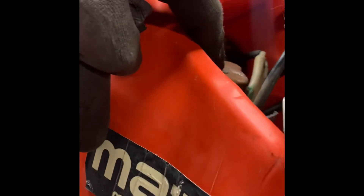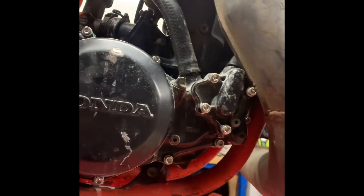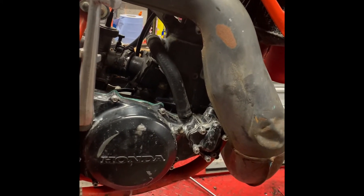Having had just another quick look around, I've noticed there's no rear brake pedal on the bike at all, and there were no Jubilee clips on these hoses for the water pump, so there's no water in the radiator. It looks as though these are fresh gaskets — it looks like someone's done some work here and they've replaced the bolts for stainless steel bolts.